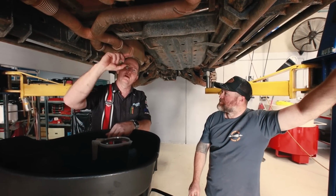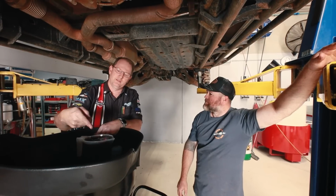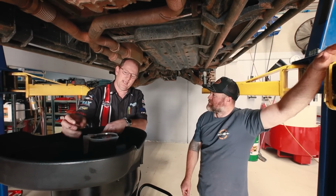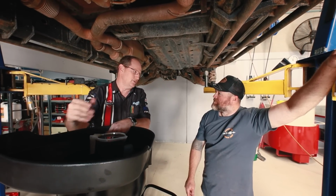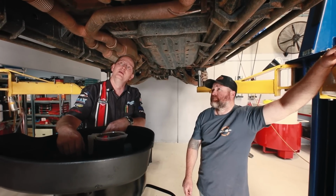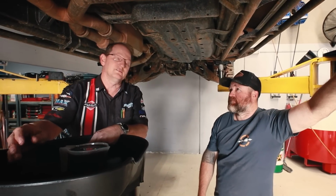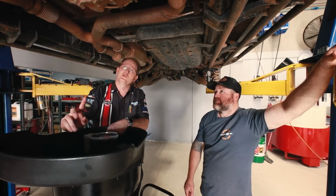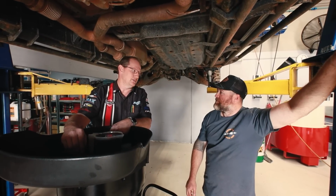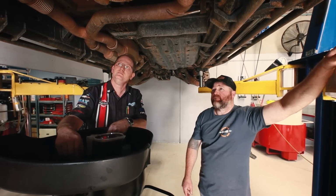All the drive for front and rear is coming through that transfer case. And you look at that oil, just how burnt and black it is compared to the new oil. It's worth changing. Oh, definitely. Even if it's not, preventive maintenance is the cure for a lot of things, I think. So we'll get fresh oil in that, and I think you'll notice a difference in the way it shifts and drives. And we'll check the transmission as well. Oh, very good. Yeah.